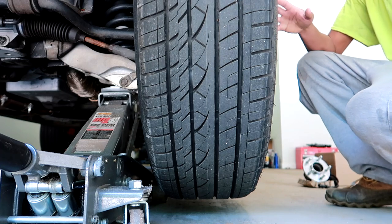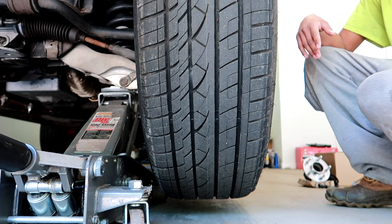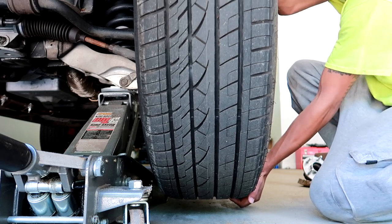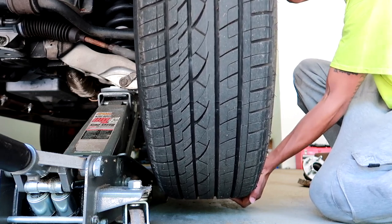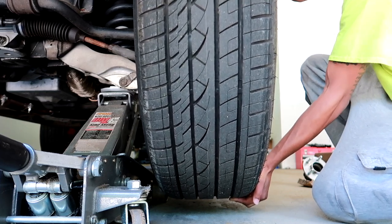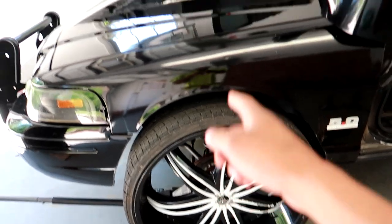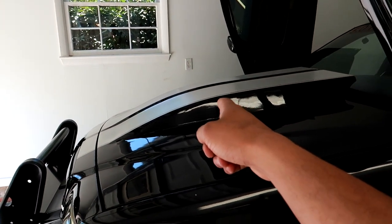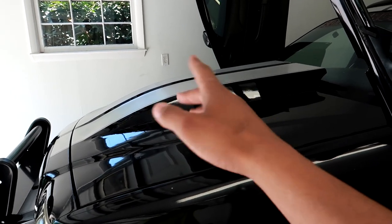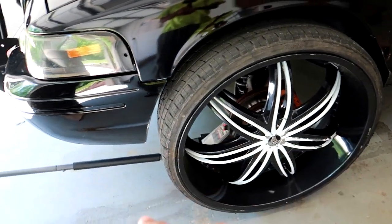While I had the car jacked up on the driver's side, I'm going to show you guys the movement I'm having top to bottom. Hopefully the camera picks it up. You guys see how much play that wheel had in it? I changed the hub assembly on the passenger side last month — we jacked the car up on that side, shook the wheel, and it didn't have any play at all. So we know this wheel bearing is either going bad or it's shot already.